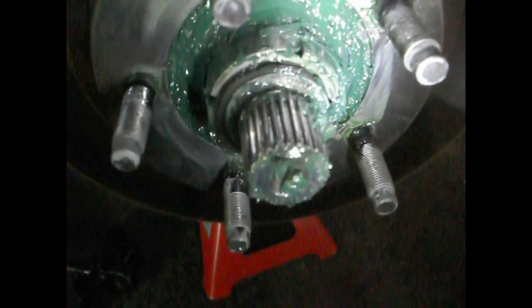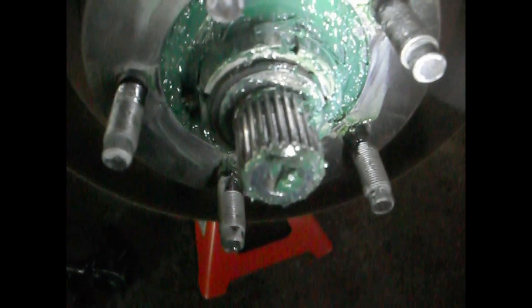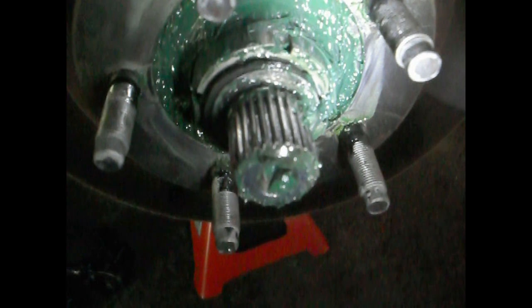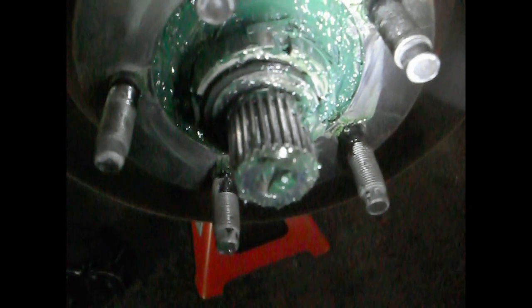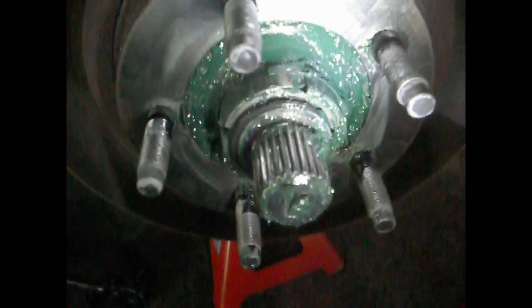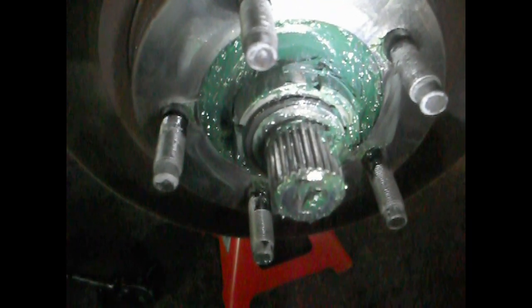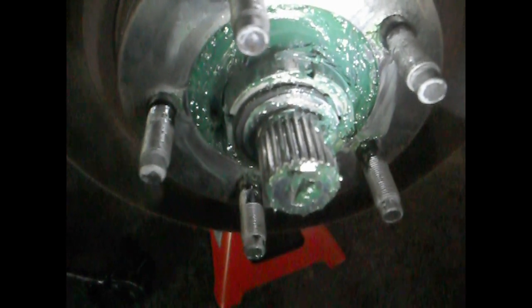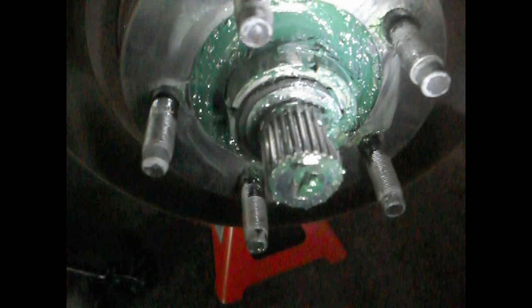You'll put on the locking ring, and then when you start to tighten up the outer lock nut, it will actually end up moving the lock ring a little bit and the inner lock nut a little bit, and that'll put more tension or more preload onto these bearings. And these guys aren't supposed to have much at all. They're only supposed to have 16 inch-pounds, and when you tighten it all up, it'll end up having who knows what, but it's definitely over 16.